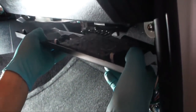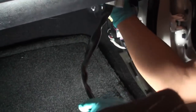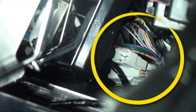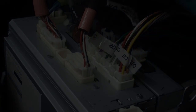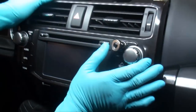Disconnect connectors and antenna lead and remove the radio and store safely. Remove the under glove box panel by pulling directly down and away. Run the passenger side of the quick sync wiring harness entering the channel along the side of the glove box to above the glove box assembly. From the side kick panel area, pass the radio connectors up through the channel to the space above the glove box. In the radio cavity, reach into the channel above the glove box and pull the harness through. Run neatly and out of the way, using cable ties as necessary. Connect the factory 10 pin and 6 pin connectors to the quick sync wiring harness, then connect the quick sync wiring harness 10 pin and 6 pin connectors to their designated locations in the radio. Reinstall all connectors, radio assembly, the four 10 millimeter bolts, radio trim panel, and all connections related to the climate control back in reverse order.